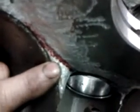Where it would just barely almost get a full revolution, but it still hit. The worst interference problems are down in here, down in the cam tunnel. Where I have the red marked became, at the very tail end, the point that had to be opened up quite a bit to finally do a full revolution. These four points — the third one back here where it's red and back over here — became the four last points, all the way up into the cam tunnel.